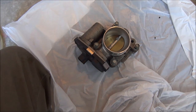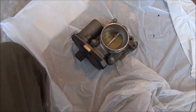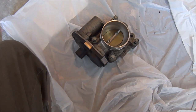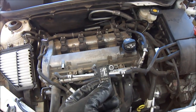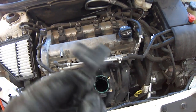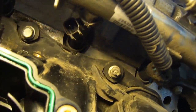You can do the reverse. You'll notice one thing though — as I was taking this all apart, you really don't have a lot of torque on these screws. You don't have to crank them to the hill, just make them good and snug and tight. Half the stuff is aluminum and you just tear the threads apart. So, this here is your MAP sensor. It actually comes out quite easy — it's one screw and then you pop it off. You'll notice the screw sits down in here, and right there is a fuel injector, and then there's a connector for the fuel injector and a connector for the MAP sensor.